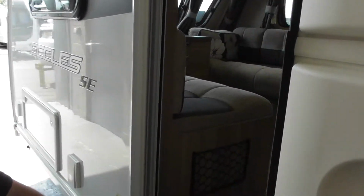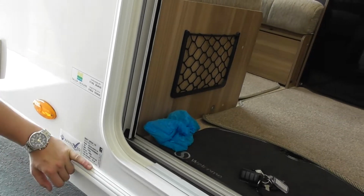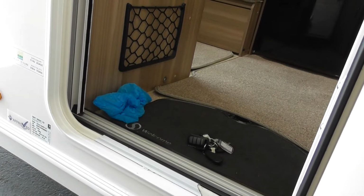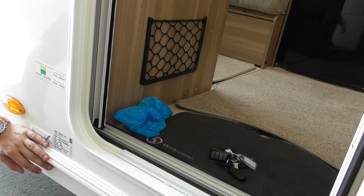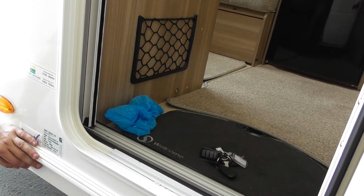On our weight plate here, we've got 62 psi per tyre. And it's 130 newton meters to tighten the wheels. I'll talk them through before you go today, and then after today it'll be down to yourselves to be checking that they're tight. If you haven't got a torque wrench, just put your wheel brace on and check that they don't move. You don't have to jump on it or anything like that. If they don't move, you're alright.